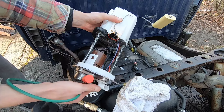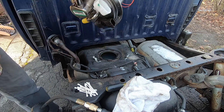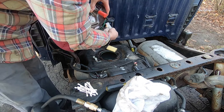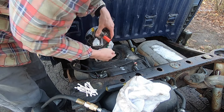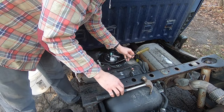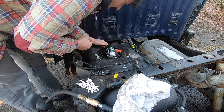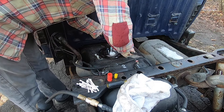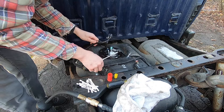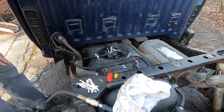I've got the new fuel pump here — it's about $200. This Bosch one came with the little O-ring, so I'm just going to put that on now. I'm going to try to feed it back in the way the old one came out. Then you pop these clips off, put this back over it, slide it on — it clips on, that pushes them there. Now we can put these plugs back in, slide them there, and I think we're just about done.